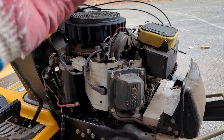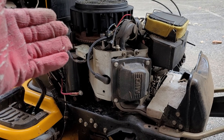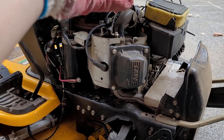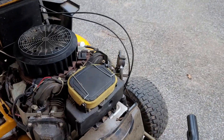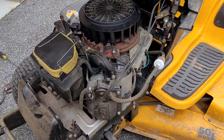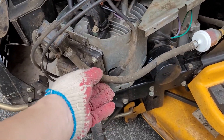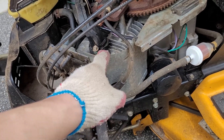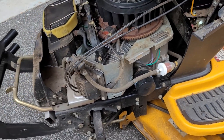If one engine is running, that means the other cylinder is good. If this one has spark, this one's good. Plug this side back in and unplug the other side — do the same thing, start it up. If it's running well it will start right up on one cylinder, then you check the other one the same way. Be careful with the fuel line — make sure there's no fuel nearby when you do the spark check, and don't jump the spark onto the fuel line.